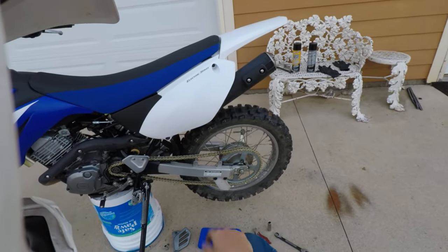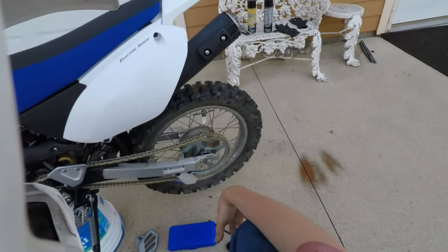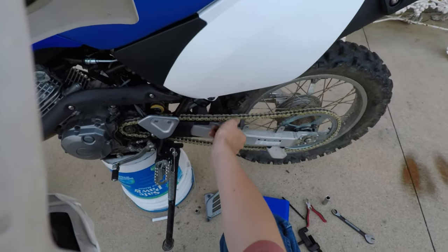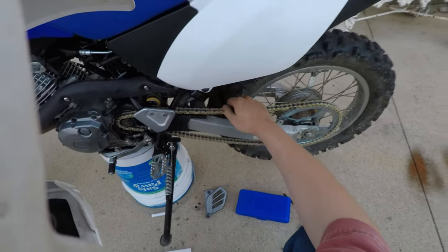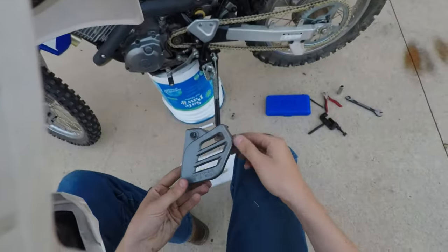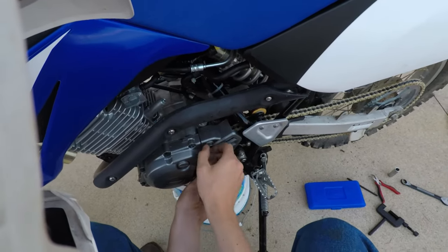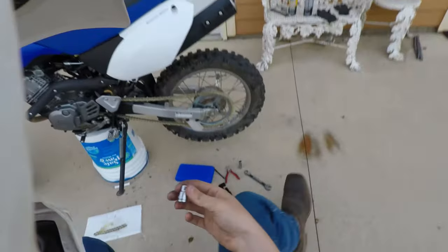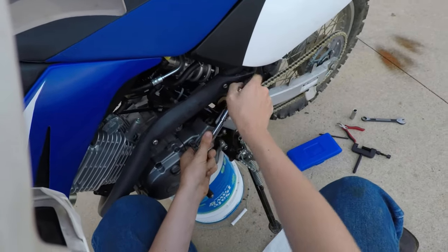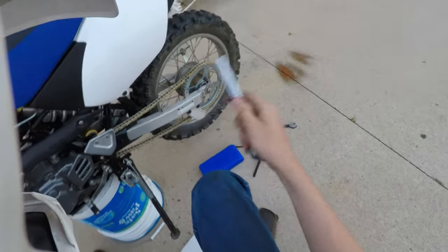Alright, so I just got the rear brake reattached. The chain is now on, cut to size, got the new link put on. It's pre-lubed actually with its own chain wax here, so that's actually really good to go. Alright, so this is what we cut off, and now we're going to put our guard back on, because safety. We'll grab our 10mm socket, grab our ratchet, make sure we're in tightening mode. Gonna snug these because they go into aluminum and we don't need to strip out the bolts already. Oh, that's good. That's plenty.